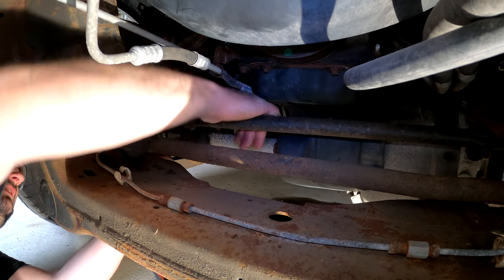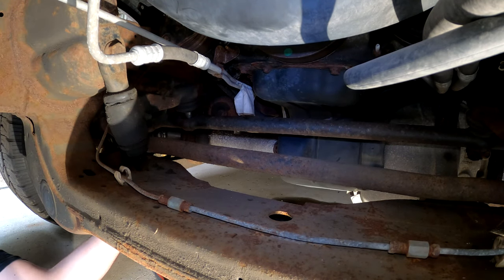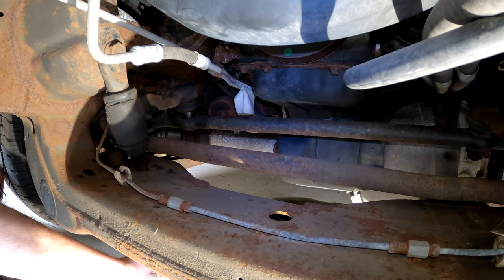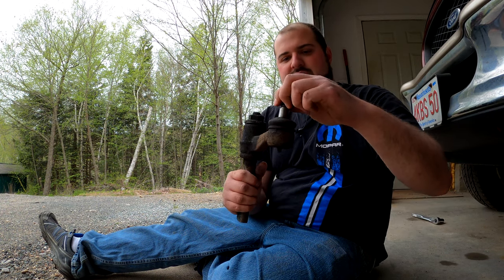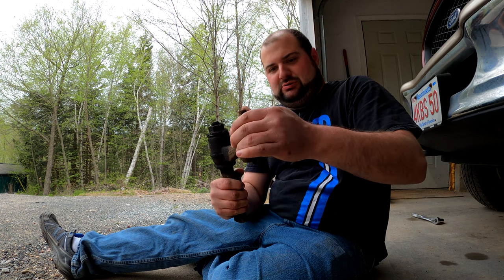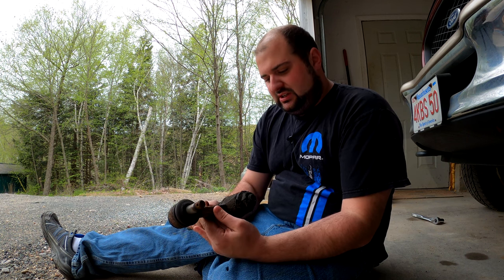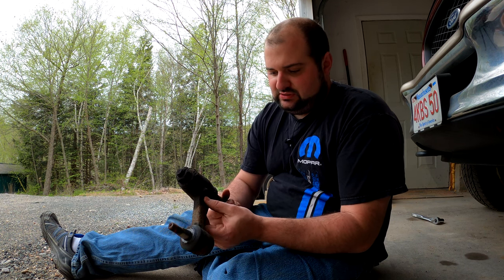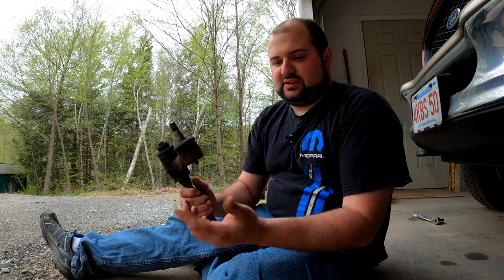You can see our center link should just sit there. We can pull these 21mm bolts out of the way and we will be good to go on this side. We've got our old idler arm out and it's not in too bad of shape — pretty stiff. The truck had a lot of play in the front end so I went through and rebuilt it because everything was original and I don't know any of its service history. A lot of the boots were all dry rotted and stuff from sitting — it's a 20-something year old truck with 50,000-something miles on it, so it's done a lot of sitting.